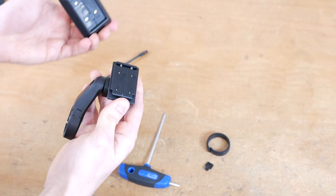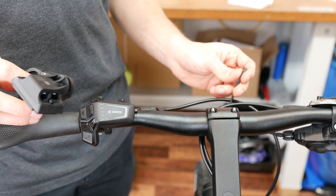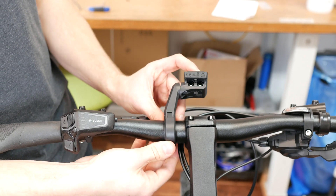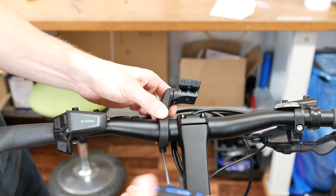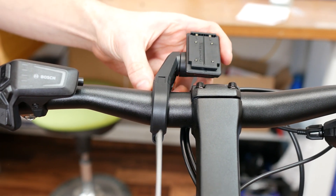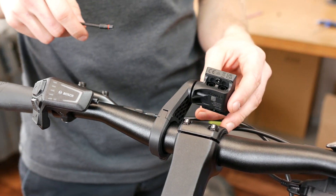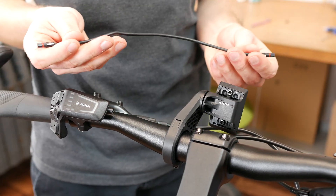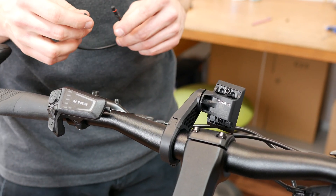Without the safety, you can easily take the display with you. Now go to your e-bike and first unplug the LED remote. Then attach the single arm holder to the handlebar, roughly aligned and tightened with the 3mm Allen key — 1 Nm is also optimal here. Before screwing the display holder, you should connect it with the LED remote using the additional short display cable. You can choose the length of this cable according to the width of your handlebar and the position of your display.